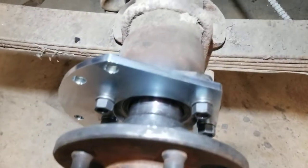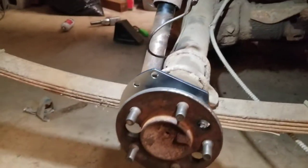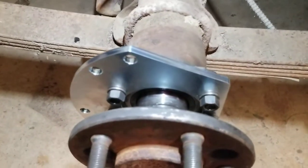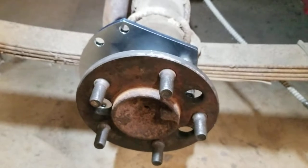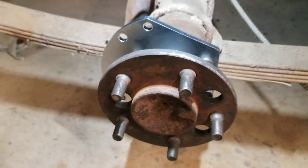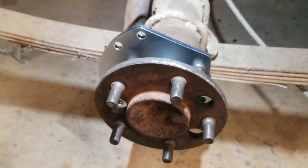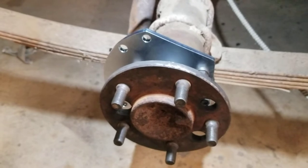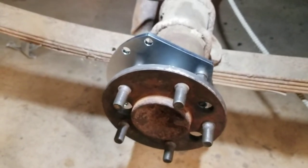Our bracket's on there — got all our bolts tightened up. There's only four on this bracket, so don't forget about your bottom one under there. You need that other one tightened down too because that's part of your axle flange — it's going to seal that oil from coming out. I'm all for power tools. I got this cool little Mac 3/8 impact and it does a great job, but make sure you go back with a ratchet or wrench and confirm it's tight. When the battery starts to wear down you can't tell — it might only have 15 foot-pounds of torque on there, and your caliper is going to fall off. Don't just run stuff down with an electric tool and say it's good. Make sure you hand check everything or use a torque wrench.